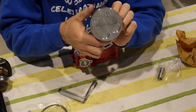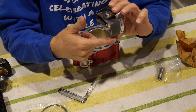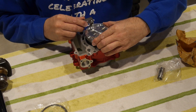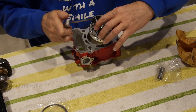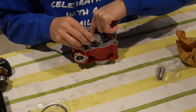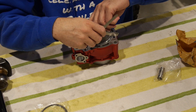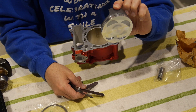By the way, pistons are oblong — they're not round. The ring lands, which are this part of the rings right here, are always smaller in diameter than the piston. The skirt, meaning the front and back, the skirt part of the piston is always the largest. So that's where you want to measure. You slide your feeler gauge down into the cylinder like this and you slide your piston down in. You should be able to move your piston down like this — it should not take much effort to fall right through. It should be that way on the top and the bottom. Sometimes I'll turn the piston upside down. Feeler gauge goes in, you just slide your piston down there, make sure it can go up and down. You can see I can move it — it's not too tight. If you want, you can put the two thousandths and check that. That's 0.05 millimeters. This one's a little tight, so it's about one and a half. So make sure you check that before you have everything ready for assembly.